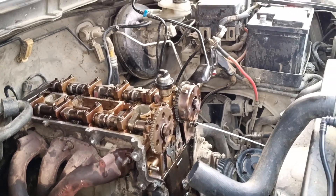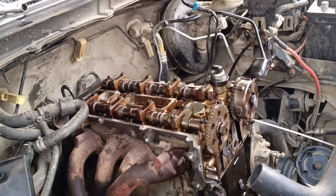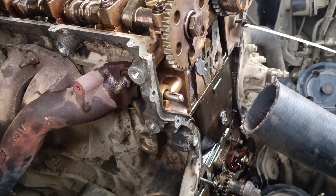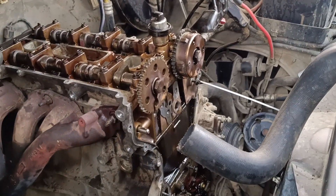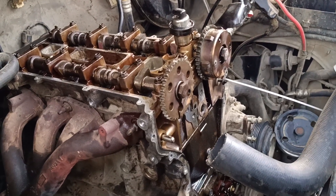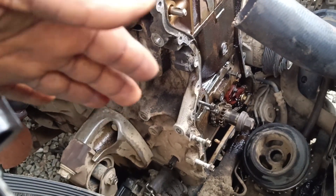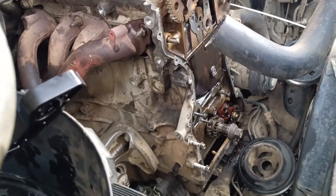Don't mind my workshop here — I have a lot of trucks moving and honking. So, this is Miami Automobile. We'll be installing the chain: number one piston and number four piston are up, and number two and three are down in this position. This is the full alignment. I'm using Evoque timing tools on this.